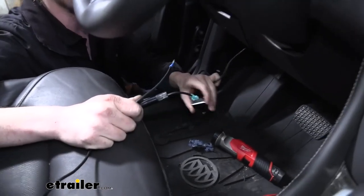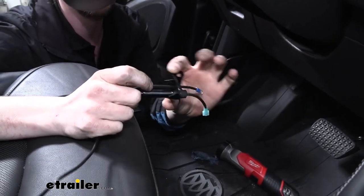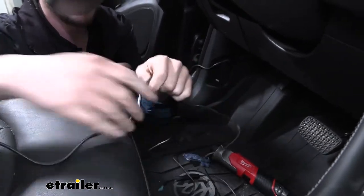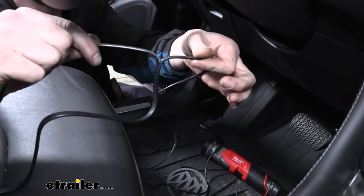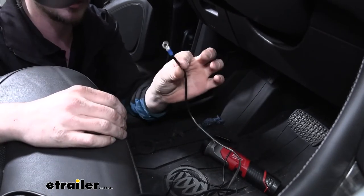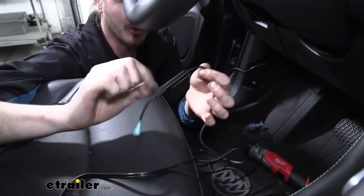We're now inside so we can pass our wires through — we're going to be connecting to our fish wire to get it through the grommet. These are our two wires. We'll take the bracket with the little prongs facing towards those wires and pull it all the way down so it sits over our 12-volt outlet for mounting. Then pull the two wires apart to get more length between them — it'll continue to split so you can get more length as needed. We'll be leaving the ground wire on the inside and connecting it there, but our power wire needs to pass out to the battery. Getting the fuse that comes pre-attached to it through the firewall can be pretty difficult because of how large it is.